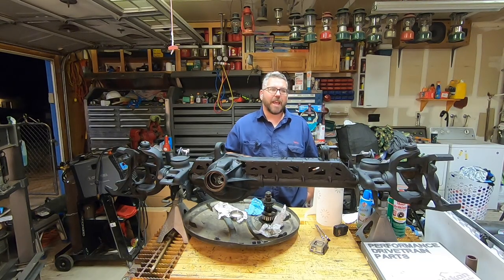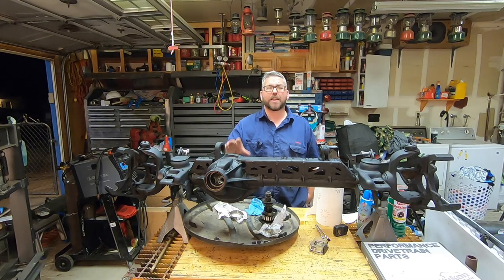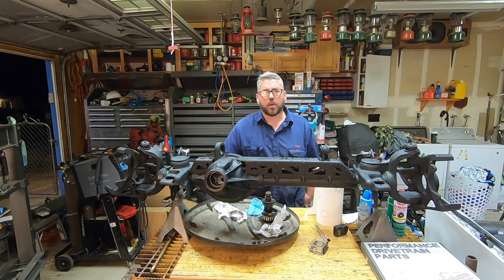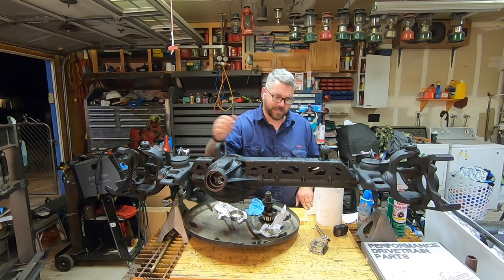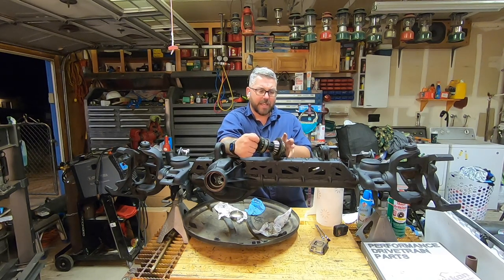I've run into a couple of hang-ups, and a lot of life has happened, so this has actually been sitting for the last couple of months and I'm finally getting to re-gear. I'm going to go ahead and install all the things that don't need adjustment — that is going to be our inner seals and the outer pinion race. I'm also going to install the oil slinger and the inner pinion bearing, because I know I'm not going to need to remove those again. Once it's set, it's set, and then I just have to figure out measurements from there.